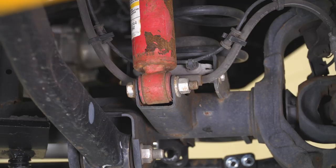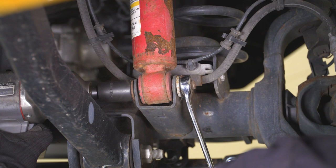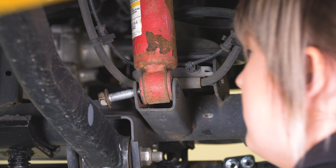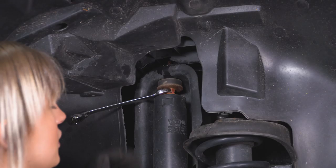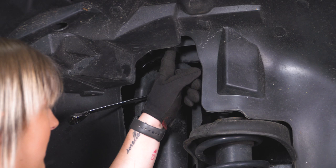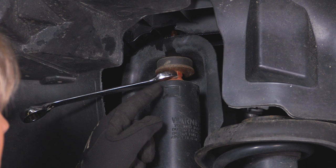We can do the same thing for the other side — you're going to have a little bit more room over on the passenger side with your impact wrench. If the axle drops and you're unable to get the bolt out, just tinker with the axle height so the shock moves more into the shock body and loosens up that bolt. For the passenger side, there's not a lot of room because of the battery box. So I'm going to switch wrenches — ratcheting wrench holding the shock body still, and 16-millimeter box wrench to get that nut off the top stud. I recommend soaking them in PB Blaster penetrating lubricant.